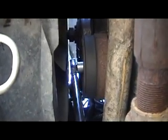As you can see, it's a 15/16 on the bolt up there, on the pulley bolt. When you hear the liquid in there pushing out, there's some compression going out too. But what you want to do is just do that. I go around 4 or 5 times each way, actually. Or if you hit resistance where it literally stops like a wall, don't force it. Go back the other way, come back around, and do it a couple of times so you can do it all the way throughout.